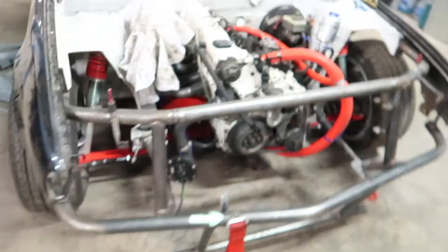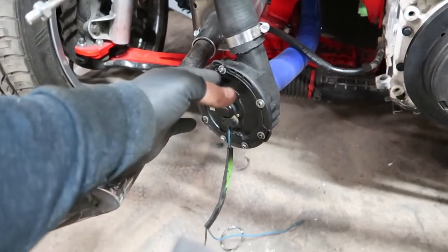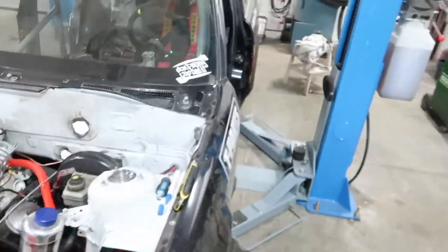Overall with this episode I'm pretty happy with how it came out - the pump is in a good location. I still need to figure out a fusing system for the pump and I need a bunch of clamps for the hoses, including under the car. I was planning on buying double clamps. The warm water going back to the radiator and the cold water going into the motor are on different sides of the car so they don't heat each other up. I'm pretty happy with the setup and I really hope it solves the overheating issues I had last year.